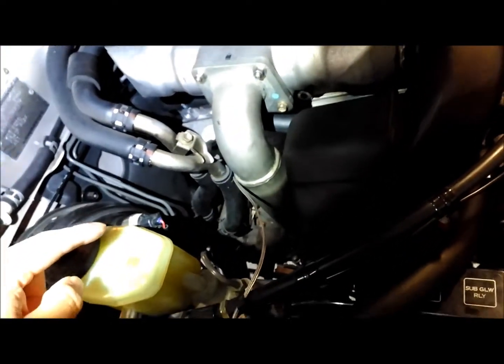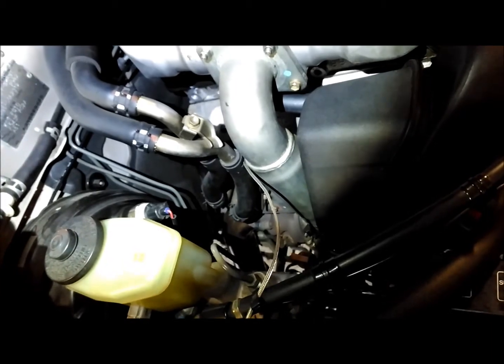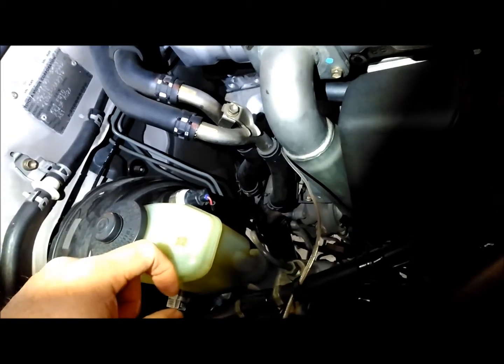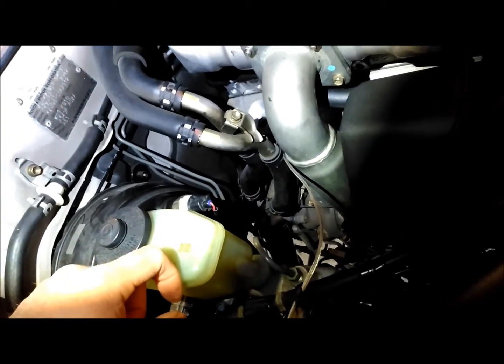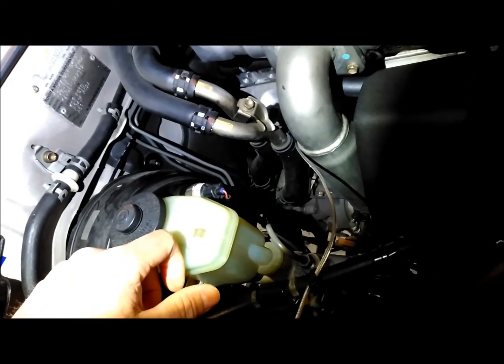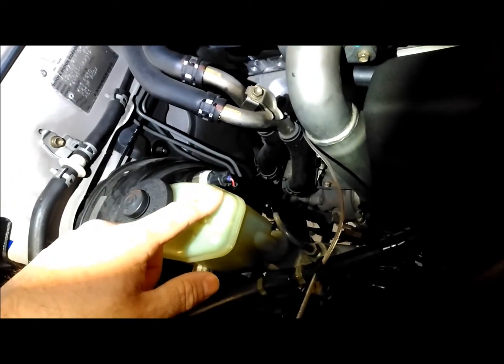The EGT's down there. I probably recommend taking the exhaust manifold off. I know some people don't — you can just leave the engine running, and that's enough pressure in the manifold to blow any filings out while you're drilling. It's just a bit tight for me. I've got a right angle adapter for the drill bit. You could put some grease on the drill bit. But I just sort of got it taken off so you can see what's in there.